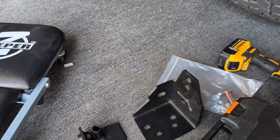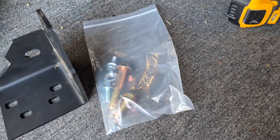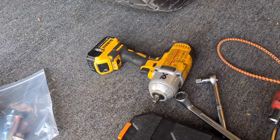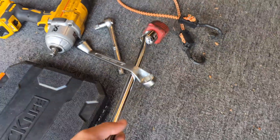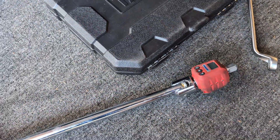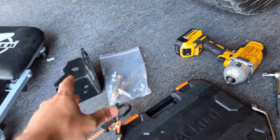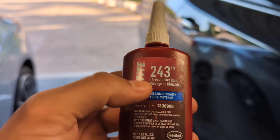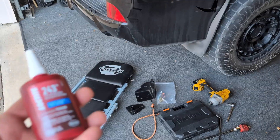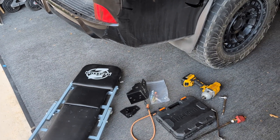Here it is. It is a combination of two brackets — this is the main larger one that goes into the cradle — and some simple hardware. What you're going to need in addition to what comes with the kit: an impact to make things easier, a wrench, some ratchets, some impact sockets, and a torque wrench. You'll also want a bungee cord to keep the panhard bar out of the way while you're doing the work, and some blue Loctite — I'm using the 243 medium strength. Links to all the tools, parts, and Loctite will be down in the description.